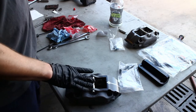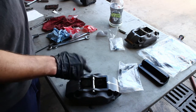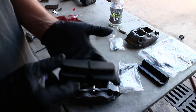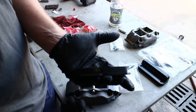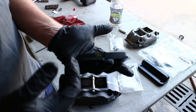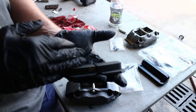One of the unique features of this StopTech caliper is this bridge bolt, which increases the stiffness. This is also available for the DynaPro calipers, but it's usually not used. These calipers use a pad that's quite a bit thicker than the Wilwood calipers. You can still get more pad volume with the Wilwood calipers if you go to the 6-piston DynaPro and a few other models, but out of the gate you're already getting 4 more millimeters of pad, so it's going to last you a little bit longer on the track.